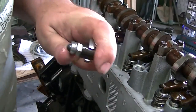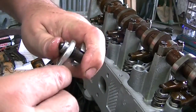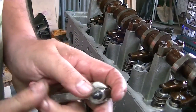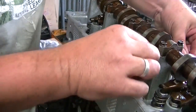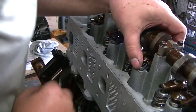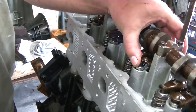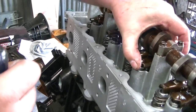When you do this on the engine, the lash adjuster seems to want to spin as well, so you just lock that into place and there you have a rough adjustment. You put that back in and pop the rocker arm back on with a trusty screwdriver. I can already feel that it's way too tight.